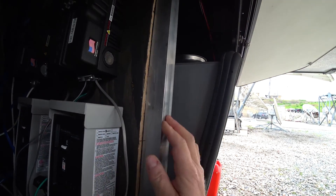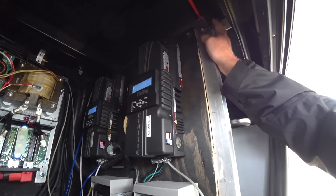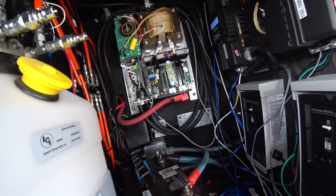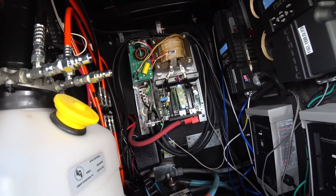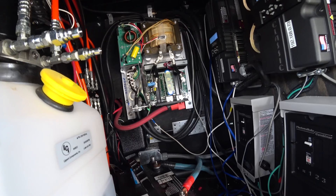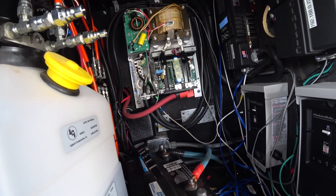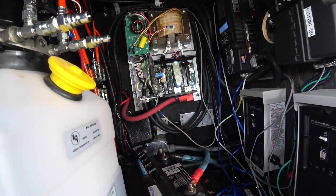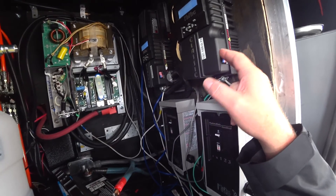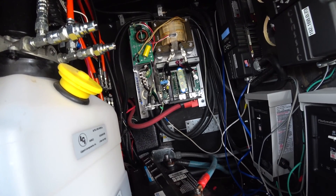We created another custom rack, mounted sideways in here. It will be tied into these top braces. And the inverter, not covered right now, is on another backboard we built — very securely fastened and backed by the other board we built in the pass-through, so it does not move. All the connectors are right there, minimizing the length of wire run, which is very important. It also gives us something that will help regulate temperature a little bit easier. We can cut some vents into this compartment so these components can vent easier, and when you monitor the temperature, you can monitor the whole compartment as well as the individual pieces.